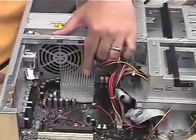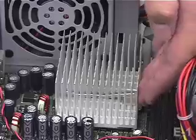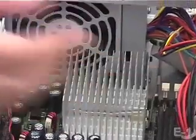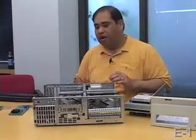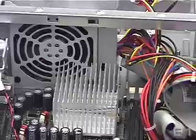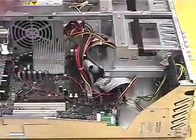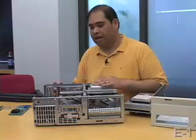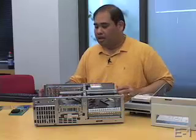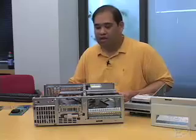This right here is the heat sink, which sits right on top of the CPU on the motherboard. It's made out of metal, and what it does is pull heat up from the CPU so that when the fans are blowing, that heat can be drawn out of the computer and a more reasonable internal temperature can be maintained. There is a fan next to the power supply and a fan in front, and the innards are designed with an air channel which drives the warm air out. That, in a nutshell, is the innards of a computer. On behalf of the E1 staff, I'm Ray Diaz. Thank you for watching Dissecting a PC.